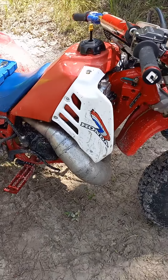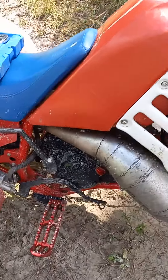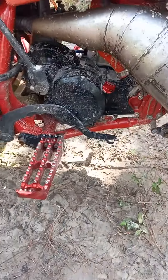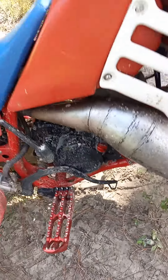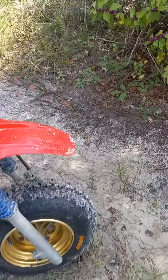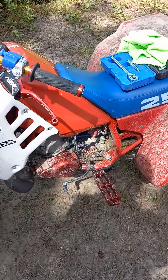I'm doing my shakedown video on this bike. I already found out that I need to do some seals — they're leaking from the shifter and behind the front sprocket.